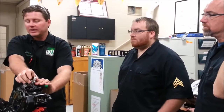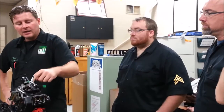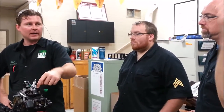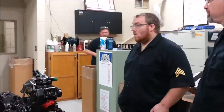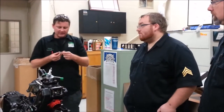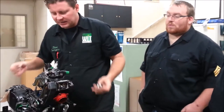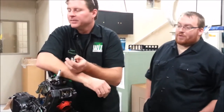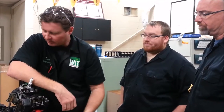Here's what you need to know. Most spark plugs are simply this: tighten them, crush the washer, and then torque to spec. The thing you have to think about with a spark plug is that we have this crushable sealing washer. Inside every other sealing washer in an engine, what are manufacturers always telling you to do? Replace them. Every sealing washer on a drain plug or anywhere says it's a one-time use.